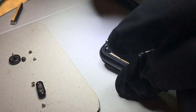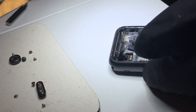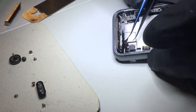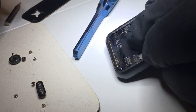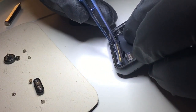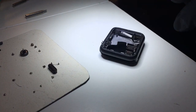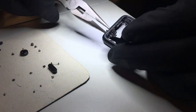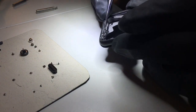Then I'll remove the three screws that are holding down the main logic board to the frame. Now we can remove the taptic engine and disconnect the Bluetooth antenna. There are two screws holding it down on the frame — go ahead and remove those, and then there's a little bit of adhesive holding it onto the back that you'll need to separate. Next, we're going to take needle nose pliers to loosen the rest so that we can release the flex cables on the inside.